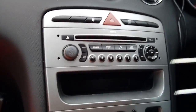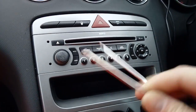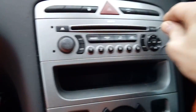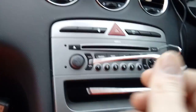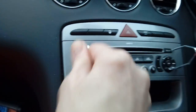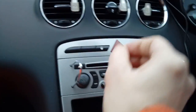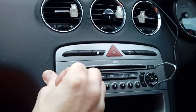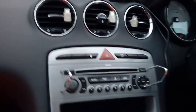Now we've established what fuse we're going to use, we can move on to actually removing the radio. This is really pretty simple on one of these. You need a pair of these universal U-keys — again, Amazon or local car shops probably have them — and you pop them in. You're probably going to need both hands for this because you need to pull them apart.